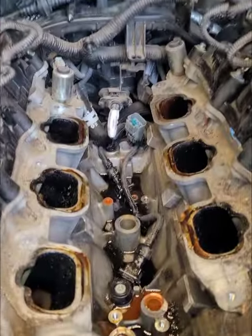The 2016 Dodge Durango — last time I had done the water pump, valve cover gaskets, and belt with both pulleys. After I tried to burp the system, the coolant temperature sensor was reading high. I had to order another thermostat housing because on the 3.6 it's an all-in-one design. I've already swapped that in, and that threw a code P06DD for a stuck closed oil pressure sensor. I've already got the oil pressure sensor out along with the oil and cooling housing.